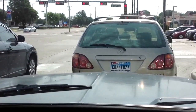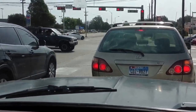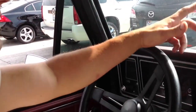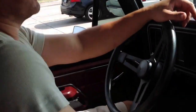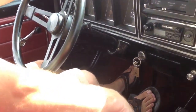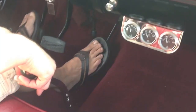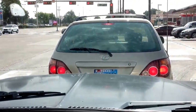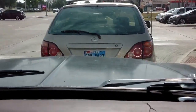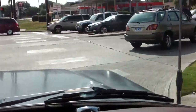There's only so much you can do to an old-school carburetor without changing it out to a modern Weber or something that's set up with Teflon seals. Ethanol dries out all your rubbers, everything. Very corrosive on older carburetors. Hence, if you've ever purchased a rebuilt carburetor, you're very lucky to have one go through your year warranty period. You can only change technology so much.